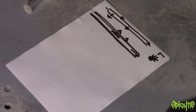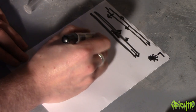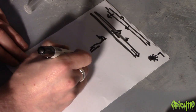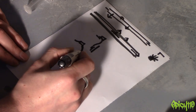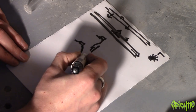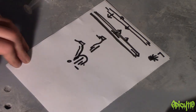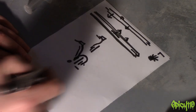On brake line setups, there are basically three configurations. The simplest: front wheel with one caliper, a brake line up to the lever and master cylinder — simple. A second version, common on sports bikes, has two discs so two calipers: the line comes down into the first caliper, and then a second line loops out of that caliper over the top into the next caliper. When pressure is applied it forces onto the first one and transfers over to the second. You'll almost always get slightly more force on the first side.